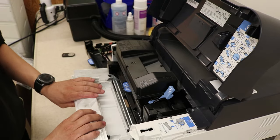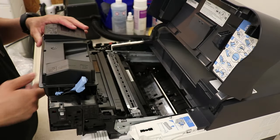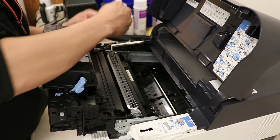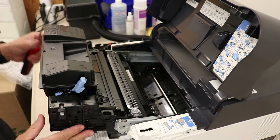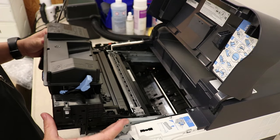Lift up your top cover, lift up the bypass cover all the way out as far as it goes. On the left side there's a little clip — just pinch it in and pull it up. On the right side, this is the way I like to do it. There's another way in the manual, but this is my little trick.